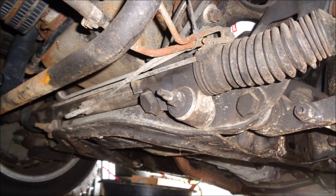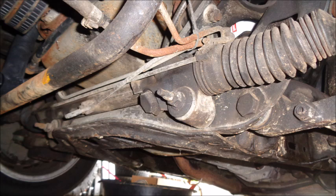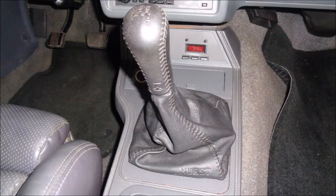As the SVO evolved, Ford fitted a 15-to-1 close-ratio steering rack to further improve steering response. Most later-model Fox, SN95, and New Edge Mustangs came with a 15-to-1 ratio rack. But the idea of improving steering response in a car meant to take on twists and turns can be applied beyond the steering rack internals — suspension bushings, steering rack bushings, K-member and strut tower braces, and caster and camber adjustments will all help.